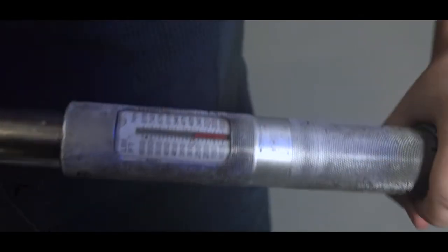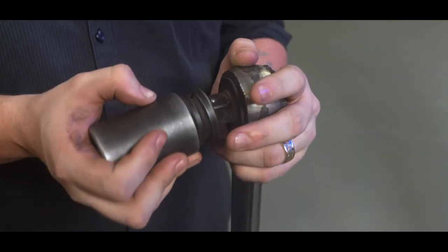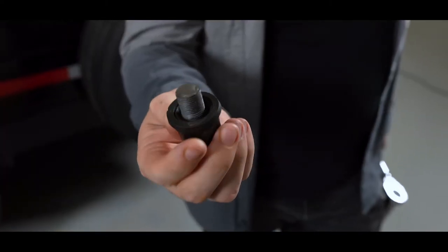The tools you'll need are simple. A torque wrench — unlike the last few videos in this series we need one that hits at least 350 foot-pounds of torque. Secondly we need a socket; in my case for this 15k axle it's a 1 and 5/16ths. Using an air impact gun can lead to stretching the threads, stripping the stud, or even shearing it clean off. Also commonly used but shouldn't be is the lug wrench from your truck — these will leave your lugs too loose as we cannot tighten them to the specific torque specifications.